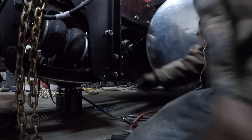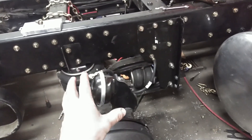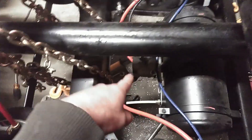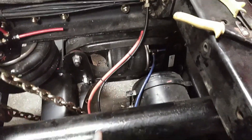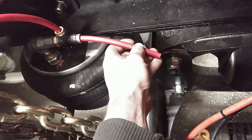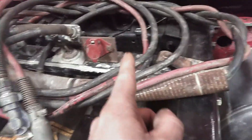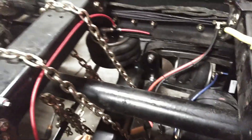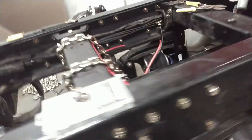The axle is all positioned where it needs to go, all the bolt holes drilled, bolted on, and ready to go — still need to plumb it. Hendrickson makes a really nice, self-contained setup here. It comes with an extra air tank and a relay valve for the brakes. You just tie your service brake signal line into that, and the air bags are already plumbed. All you have to do is run your control box air from your truck's air tanks to this, and plumb your lift and lower bags.